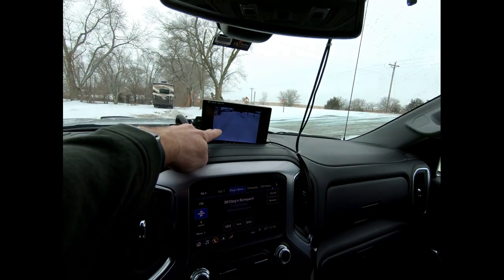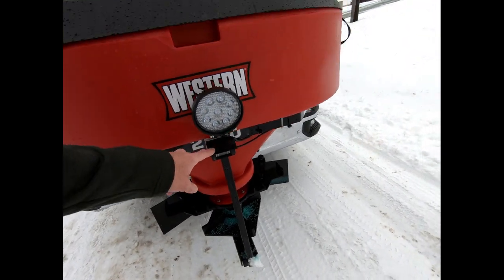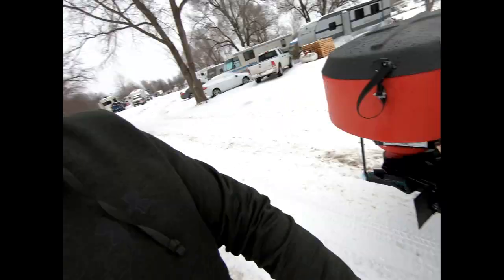Now's a good time to like and subscribe if you like what I'm doing with this channel, if you like some of these upgrades I've made to the truck, or if you have questions about the equipment I'm using, go ahead and put that down below. I did set up an external camera — let's look at that real quick. With the salt spreader on, my tailgate camera doesn't work. I'm Mr. Safety, so I wanted to be able to see behind me. I installed this camera and routed the wiring underneath the truck up to the front — it's just 12-volt so you plug it into a cigarette lighter, though you can hard-wire it as well.